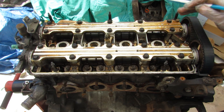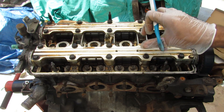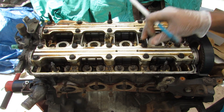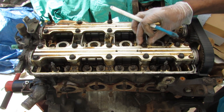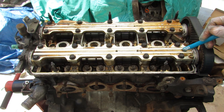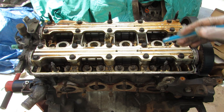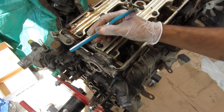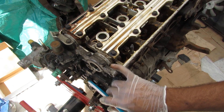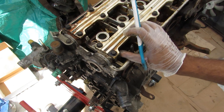One thing I like about this engine is it's kind of over-built. Most engines just have a small semi-circle covering the cam bearing with two bolts. Honda has extended the support to the other side and added a long brace running along the engine to make sure those camshafts stay in place when VTEC kicks in. At the back of the engine you can also see the VTEC solenoid, which redirects oil from the oil galleys out to the camshafts to activate VTEC.